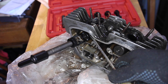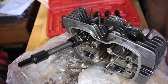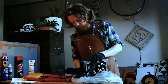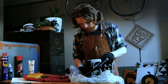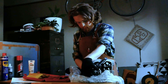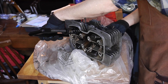So we've pushed the valve spring down and there's two little pieces, and I've got a magnet on the end of this so I don't drop them. I'm going to try and keep all of these together and marked up where they've come from. Now when I release the valve spring compressor, the spring will go over the end of the valve stem and the valve will fall out. You can create a valve spring compressor with a bit of pipe and a G-clamp, but this kit was under 20 quid delivered.